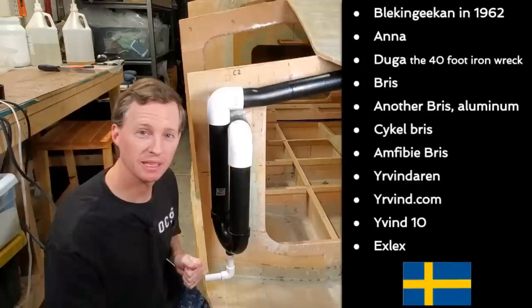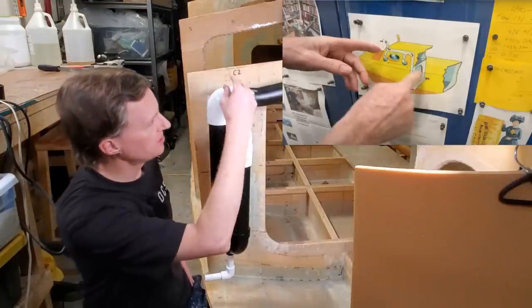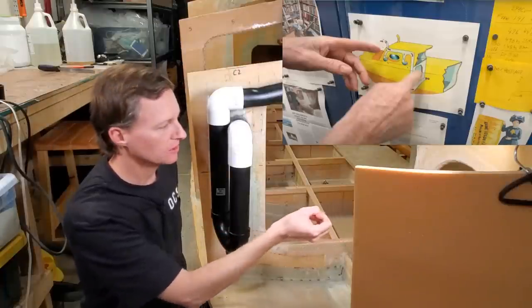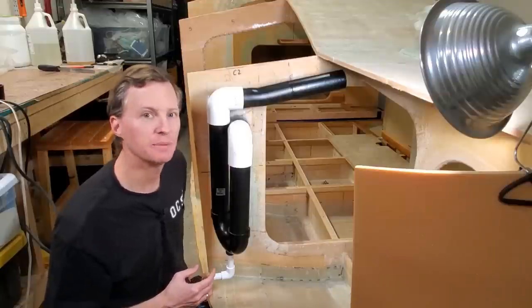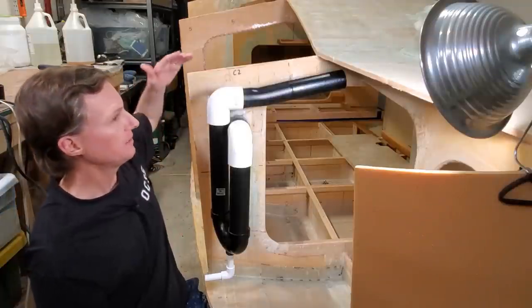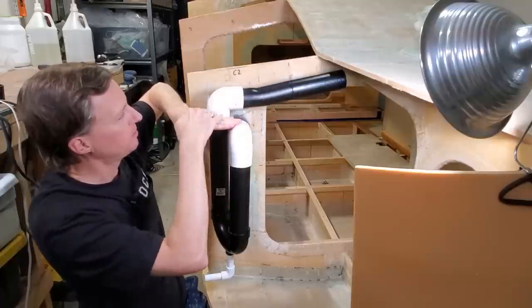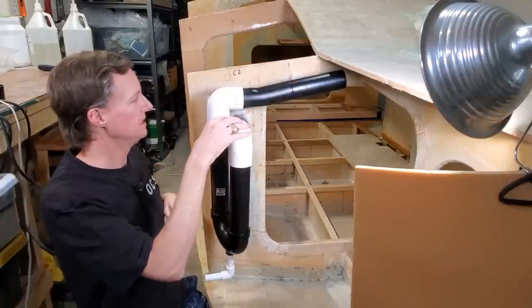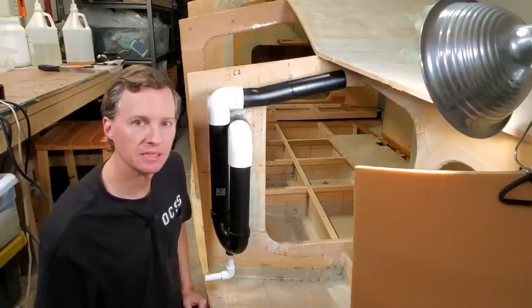Make sure you check out his channel and subscribe, because he's been doing a video per day for over a year now. One difference in his system is that he likes to run from one side all the way down along the hull bottom and over to the other side for the cabin vent. I wanted to replicate it, but ultimately decided to save on time and money and only take it this far. I feel okay with this system because even if the boat's upside down, the new waterline might be right here. This pipe would fill with water, but it would have to come all the way down before it could pour into the cabin. So I'm confident this system will work really well to keep out water, even in a full rollover.